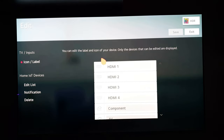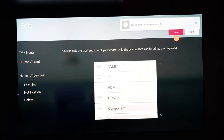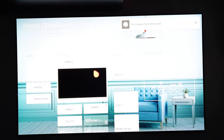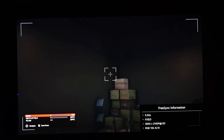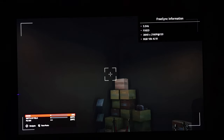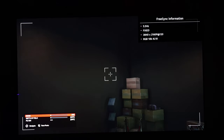Right now we are in HDMI mode — I think it was HDMI 2. Let's see what happens. Yeah, it looks like that was correct. Color banding is completely gone — completely gone — there is no color banding at all anymore, and we're still in the same 120Hz, RGB, 10-bit, 4K.